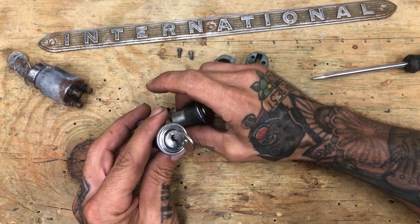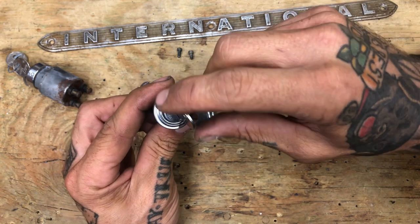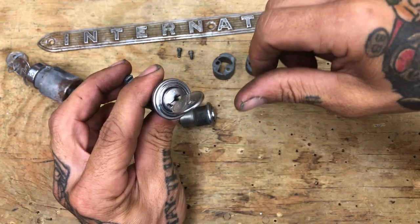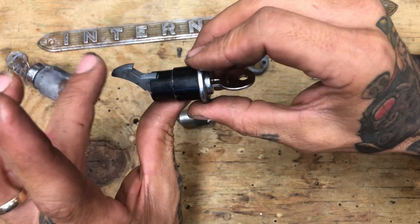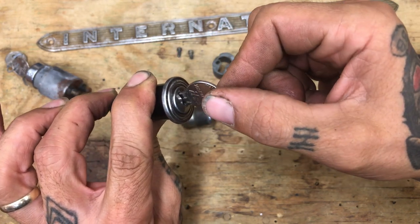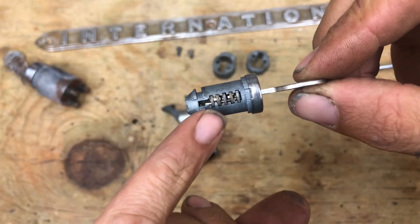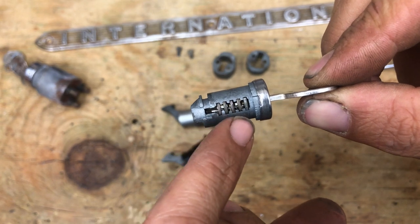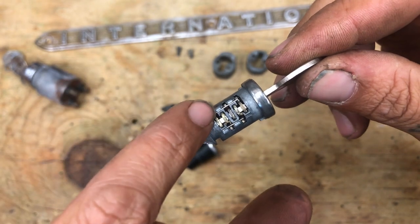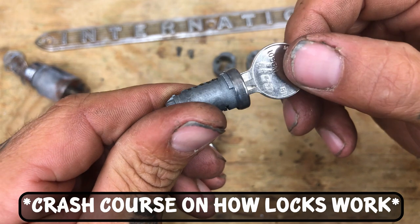It's not very intuitive unless you have a keyed version to know how to take these apart. Right now straight up it's locked, now it's unlocked. A quarter turn clockwise is unlocked, and then if you take your finger and push down on the latch and turn it another quarter turn clockwise, you can pull it right out. Here's your lock cylinder. See these guys right here — those are lock tumblers. They're held in with these two wires. When you stick the key in, they correspond with the teeth.